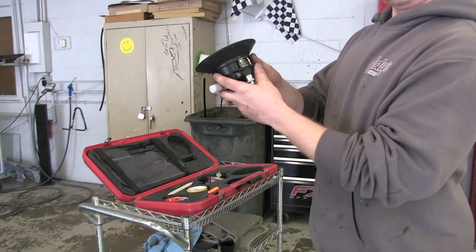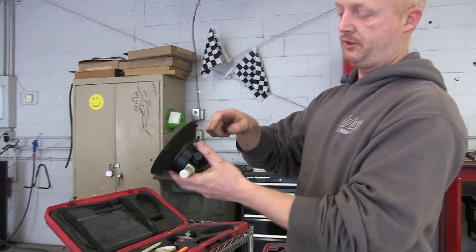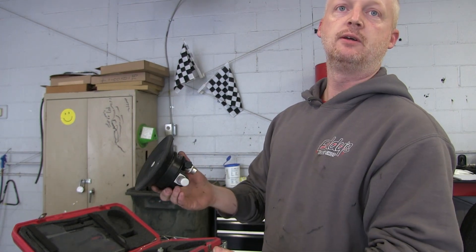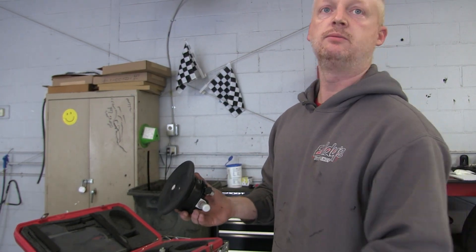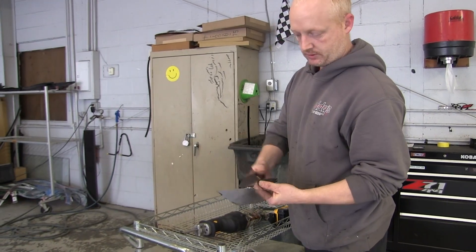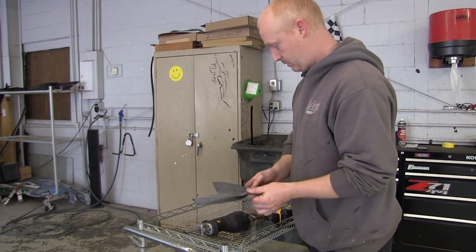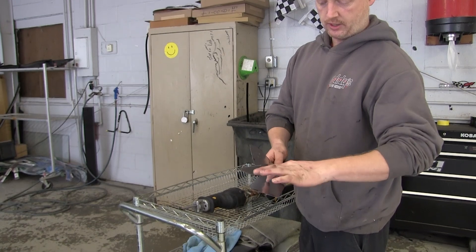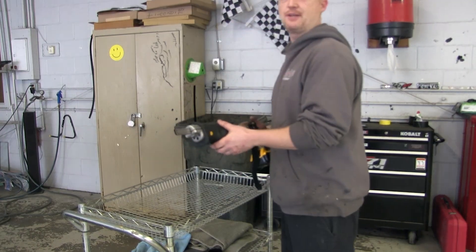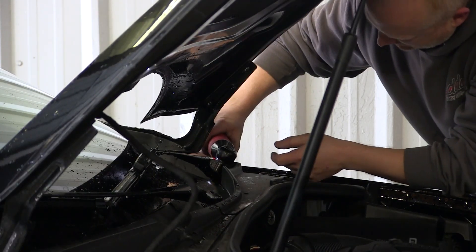What it does — it just suction cups to the window, and you wrap the wire around the windshield and hook it in, and it just ratchets. It pulls the wire in and cuts the glass out for you. It doesn't do any body damage to the car — no scratching, no issues that way. He's also showing us some different blades he has for the Equalizer. We have one of these at the school which works really well, especially for the bottom of the windshields. It's basically just a reciprocating saw with a real long blade that can cut the glue.